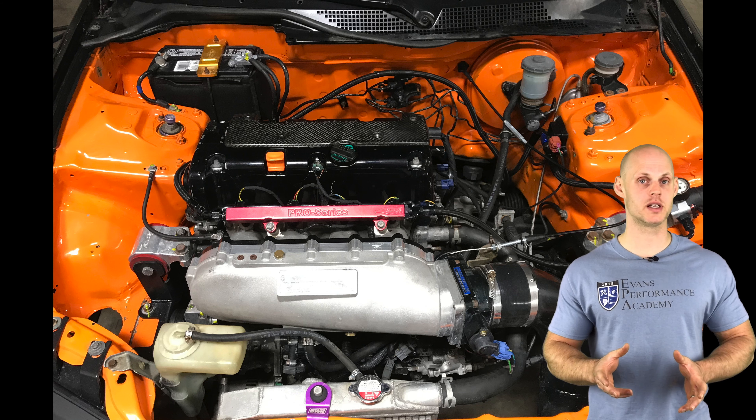Going down the list there are a ton of different file choices. In this situation, there's no choice in the directory that's compatible with what we have here — we're creating everything from scratch. To keep things simple, I'm going to start with the K20A2 RSX stock cal file, so I know I'm starting with something unmodified.